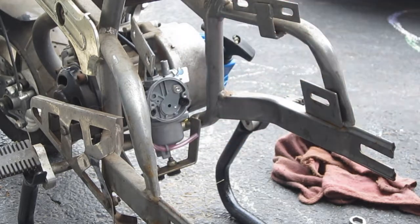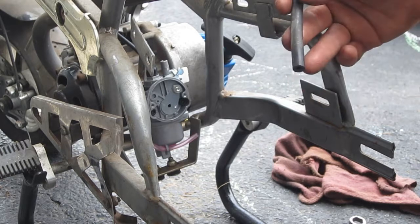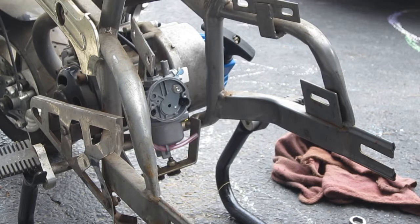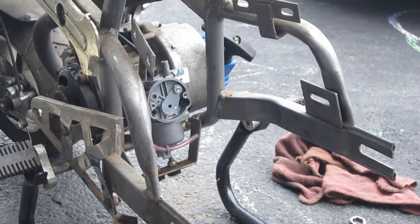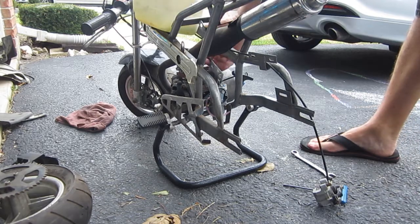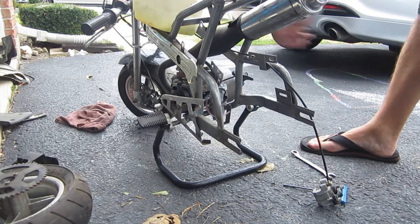Choke works — cool. New fuel lines, new clamps — I'll put a new fuel filter on, just kind of line it all up and put a new gas tank in, and that's it for a carb, pretty much — nice and easy. I didn't show putting on the hoses and the fuel filter — pretty self explanatory. These little crappy clamps — I don't have any regular clamps right now, so I just use a zip tie here and crappy clamps on the filter. Make sure that's out of the way and doesn't hit the exhaust.